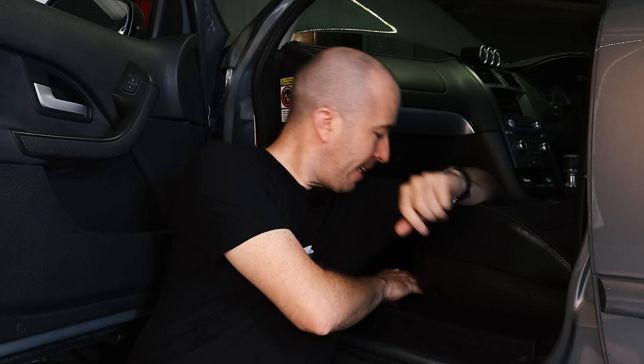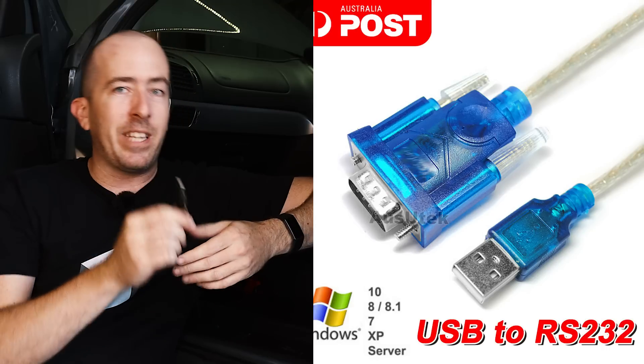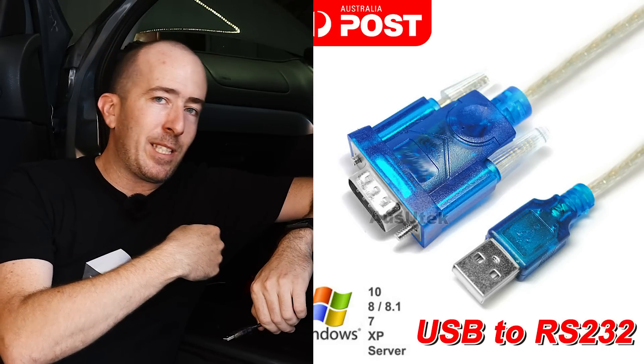The only other thing I needed was a serial connection. A COM port was really old fashioned technology from PCs around the year 2000, and modern PCs don't have that kind of connection. But luckily on eBay you can get a serial to USB cable, and that's exactly what I've got. The little RDP piggyback ECU is lurking behind the kick panel on the passenger side. I poked the COM port out from behind that panel and plugged the serial cable in. If I can connect successfully, I'm not going to make any changes — I just want to have a look, because I don't want to mess around with how this car has been set up. Tuning is what tuners are trained and paid for.